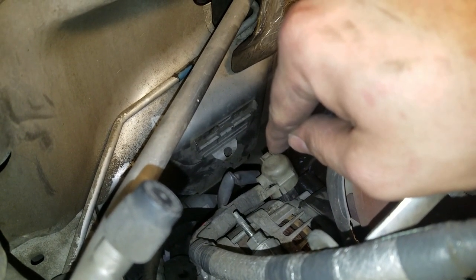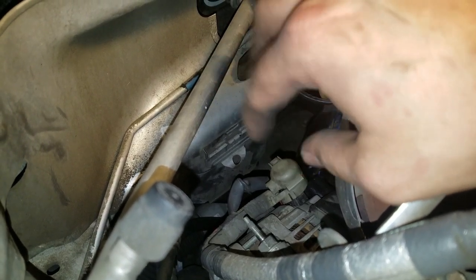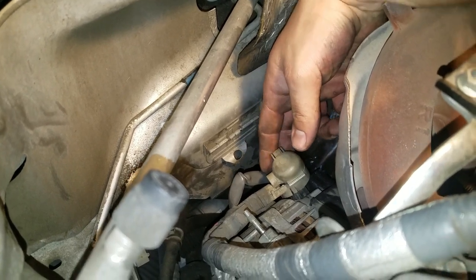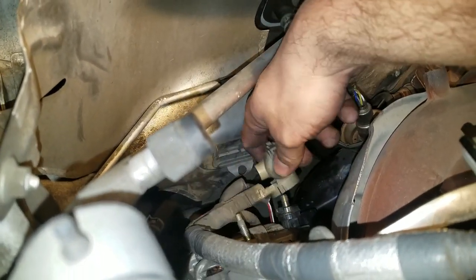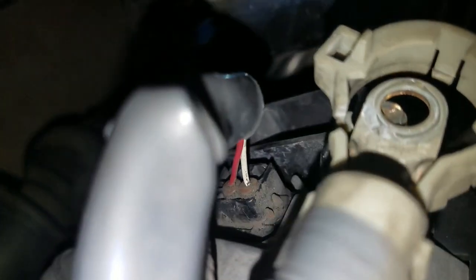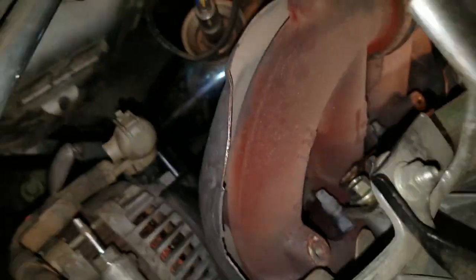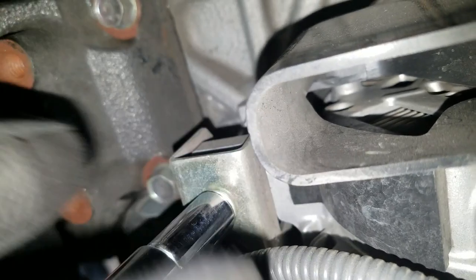This little plug has a little clip on it — it just clips off. Be very careful; it shouldn't matter but it's beneficial because it covers it from any moisture, and it does cover the bolt underneath. That is a positive wire, so we're going to go ahead and remove that nut — that's going to be a 13 millimeter. Then there's a clip-on wire; you want to go ahead and press it and then pull at the same time, just like any other wire on the car.